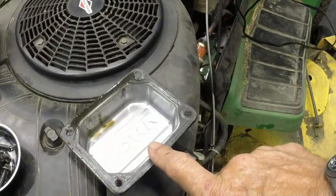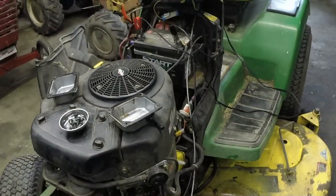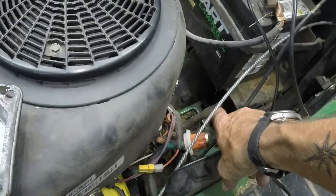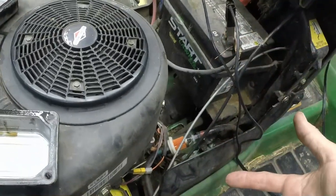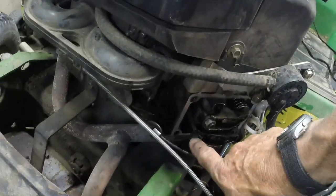The first part of the video you guys heard about consumables, which I'm going to reiterate — the valve cover. You take the valve cover off, that gasket has seen its existence. They do make valve cover gaskets like for Chevy small block 350 that can be recompressed a number of times, but in this case no. It's also got a motorcycle-style fuel filter and it's bone dry and empty. I did crank the engine over so I could watch the valves.